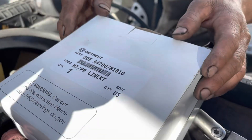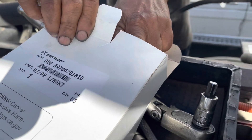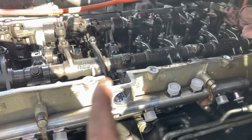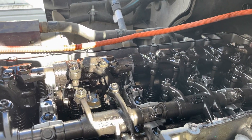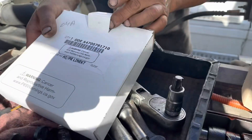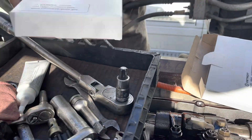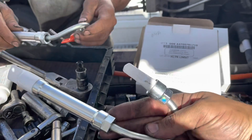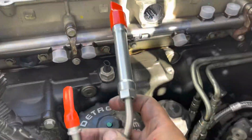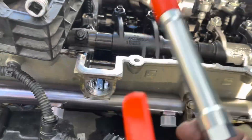These are the two lines — one ending in 1810 and one ending in 1710. Depending on which direction is forward facing — injectors 1, 2, 3 or 4, 5, 6 — that determines which line goes where. They come with different covers: one has a white jacket and one has an orange jacket, which helps you distinguish which is forward and which is rear. I believe the white goes forward and the orange goes toward the rear.